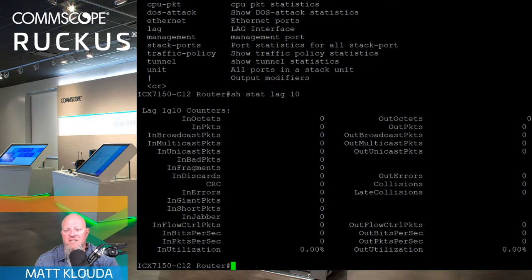So what we tell people, if you're seeing performance not really being the best that you want it to be, try the BSS min rate. In fact, here's a great example. My daughter last night was trying to watch Netflix before she went to bed, and it was not behaving. And so I had to go in and follow my own advice, because I have three access points in the house, and I set the BSS min rate to 12. And it changes it for both 2.4 and 5 gig radios. Every single client I had connected to Wi-Fi in the house moved to a different AP as soon as I did that.